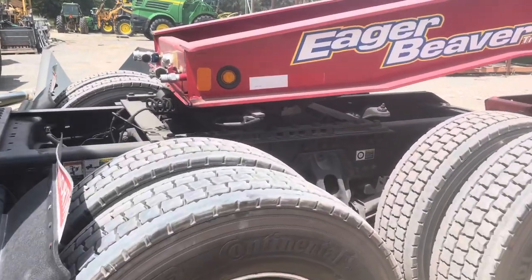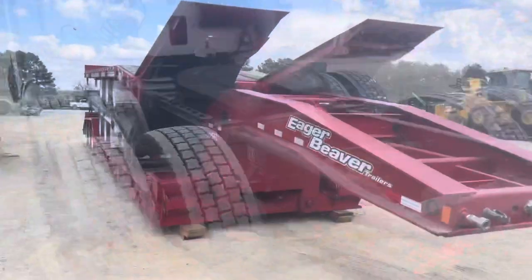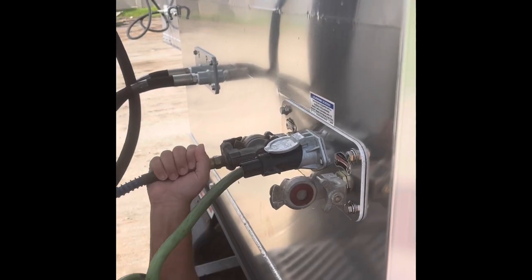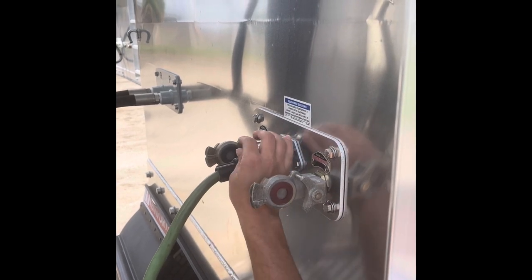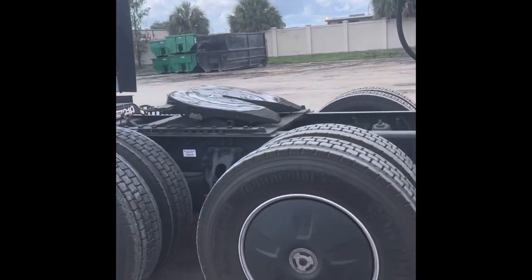This goes in that spot there. Pull it out — the release has been pulled. Right out it comes. That's it, guys. We're out here. You drop the feet on an unloaded trailer, get the feet down to the ground, come over here and disconnect your lines. It's real simple — you turn them and they disconnect. Turn it, it flaps off. You hold the top of it up and it got out from underneath of it.